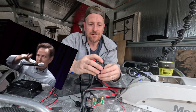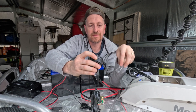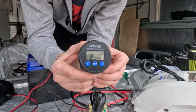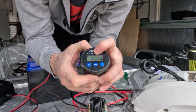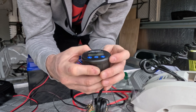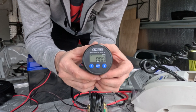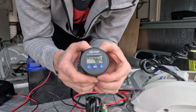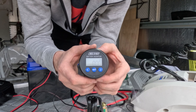And there you have it — everything is set up and good to go. Up first is the voltage: that's how many volts your system is putting out. With my batteries, I've got a 24-volt system, but it will read higher — these are lithium and they always read a little bit higher — so we've got 26.68 volts. If I hit next, it'll come across to the amps. It's reading zero because I've got no amp drawage coming from it. It might flicker a little bit if I get a GPS lock, but it'll be so low you won't even see it.